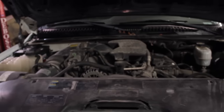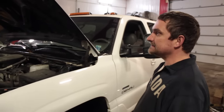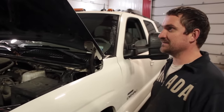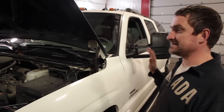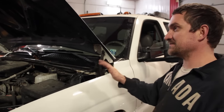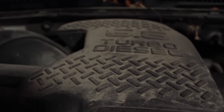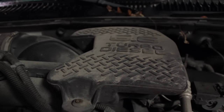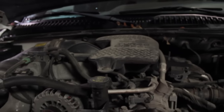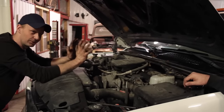Computer-wise it's all factory other than programming with EFI Live. The ECM came with the Duramax donor — it was a rollover — along with the motor, transfer case, rear end, rad support, all computers, and wiring. What we do with EFI Live is change the VIN number in the diesel computer to match the truck itself, then reflash so they relearn each other. When you scan it, it's the same VIN number it's always had — no engine lights, no codes, nothing.